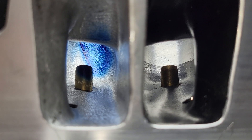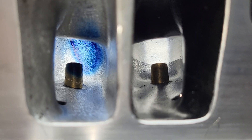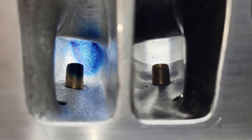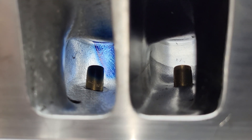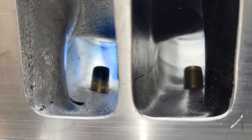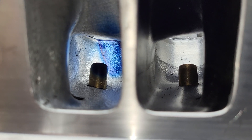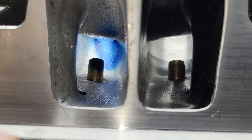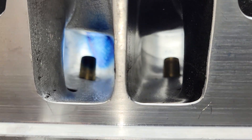Looking down its throat, the straight wall is pretty straight. I wasn't going to go crazy — I didn't want to break through the bolt boss. I could probably move that short side wall over a little bit, but I've got the short side speeds right about where I want them, so I'm going to live with that. The pinch was made a little bigger and I did a light texture on the curved wall.